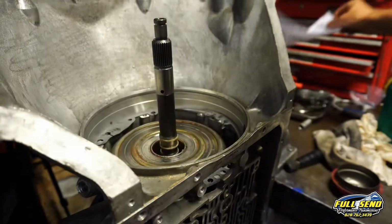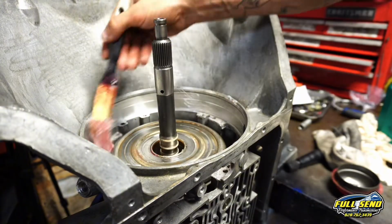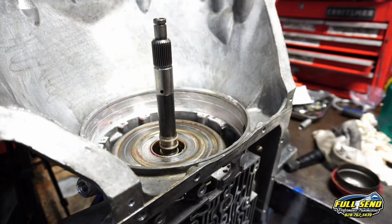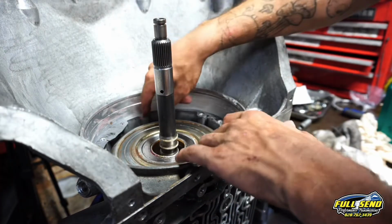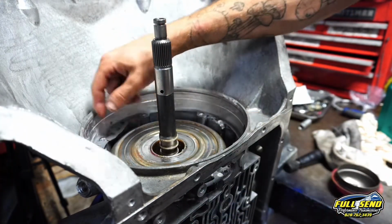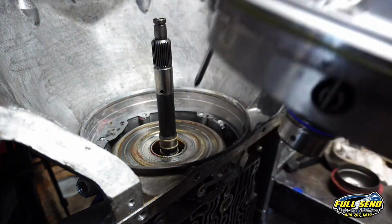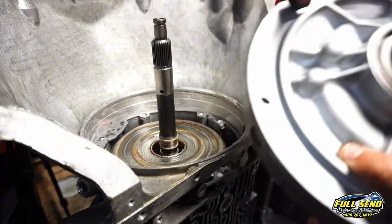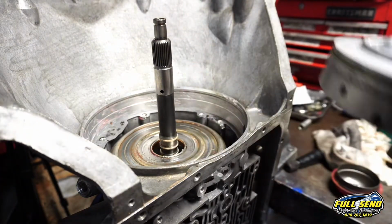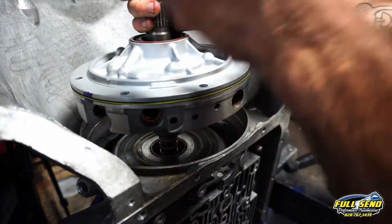Okay, good. Great. Now, you can put a little bit of lubrication here just to get that gasket seated on the surface properly. And line all your holes there. Shoulder goes up to the left, top left corner. Now you want to take a small screwdriver and put it inside of your pump just like this. I put it above the two little holes that we talked about earlier while we were putting our pump together. And that's the upper hole here. Now we got our seal here on the side, and we've got our washer on the bottom.